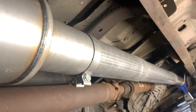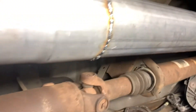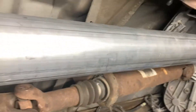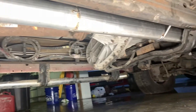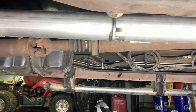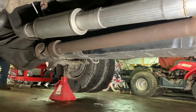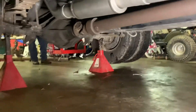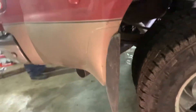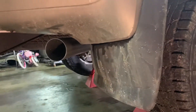We welded two joints right here on this straight part because they'll never need to be undone, and his muffler's clamped so he can always delete his muffler later. All done with the exhaust - everything's tight. Welded our hangers on, welded that hanger there and welded the hanger back there behind the muffler. Everything's straight and he's got his exhaust pointing out where he wants it, so he can add a tip later right out the back.